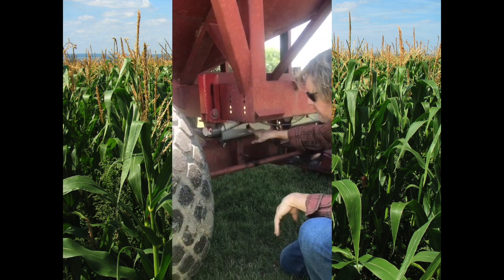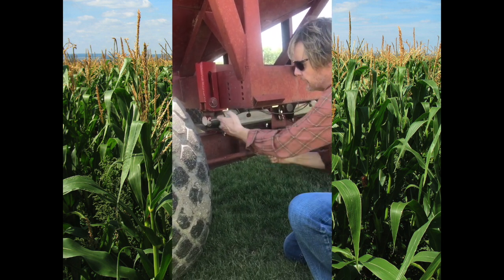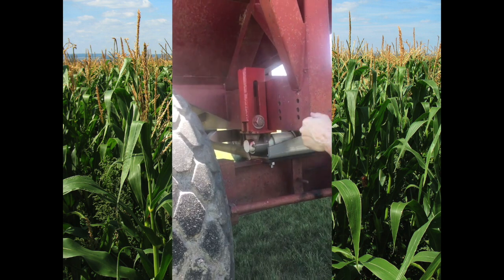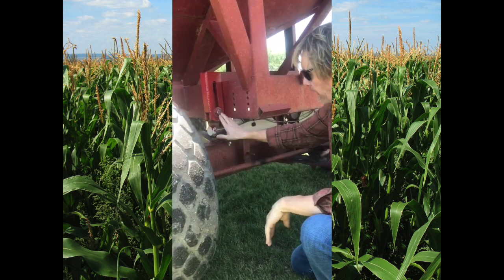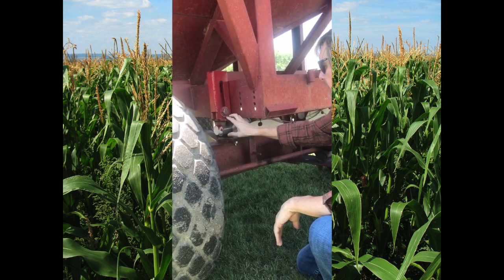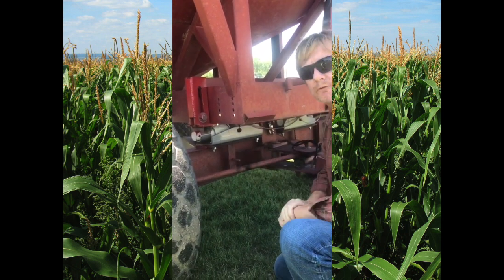To recreate that flexibility, we've mounted our bar solid, but we have this scissor bracket — this slotted bracket here. There's a metal bracket at the slot, and the slot allows us, as we go through dips and valleys, to move up and down. This keeps the flexibility in and helps ensure none of the brackets get compromised, cracked, or need repairs, because this thing can flex like it was originally intended to.